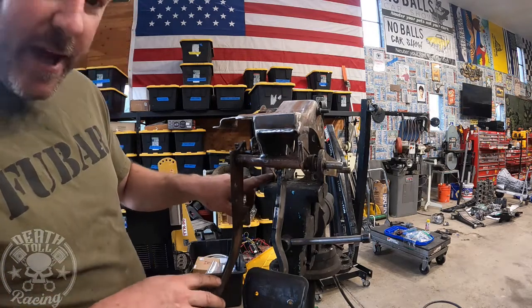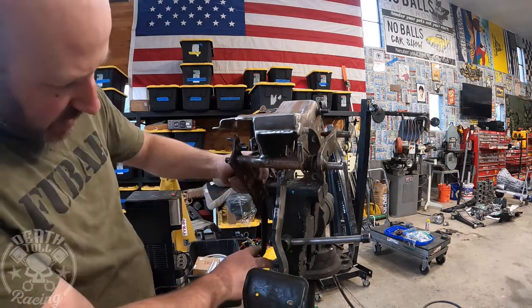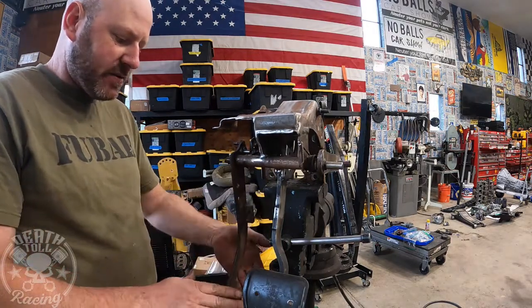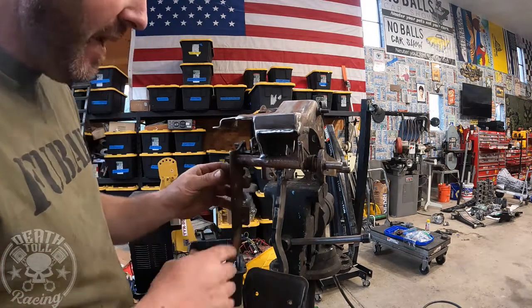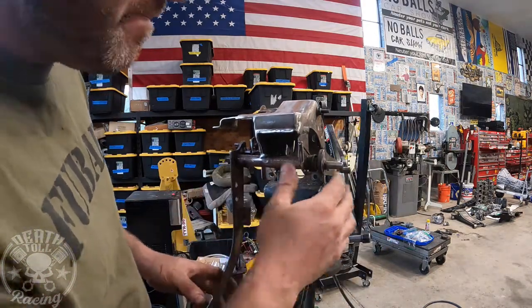But I figure we could probably add something down to this bottom bolt hole, basically like an adjuster that'll hit that pad. But this thing hits the floor, just this angle is just perfect. So it just hits the floor. So I'm hoping that that will be enough of a stop without overthrowing that slave cylinder.